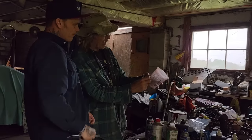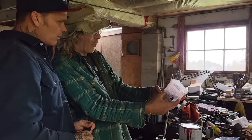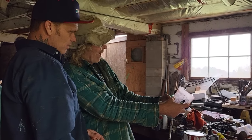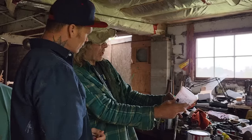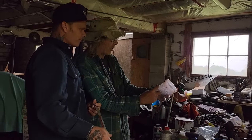Okay, just paint alone, right here, right? 4. Paint, 4. Now, the old way I did it was 4 here. Yes, and then you... Okay, well, that's twice as much paint. And then you go that much hardener. Well, that's twice as much hardener. Yes. And then you go that much reducer, and that's twice as much. So in a way, that's the same thing as going this outer line, because it's just a bigger amount.